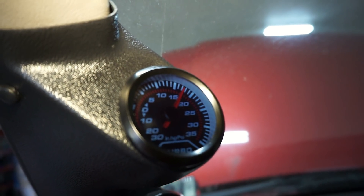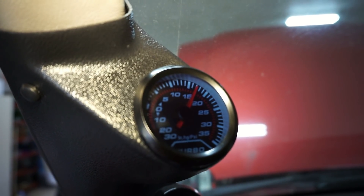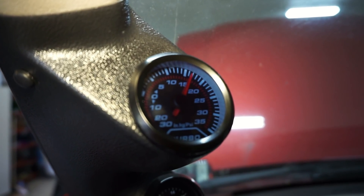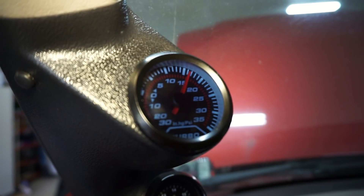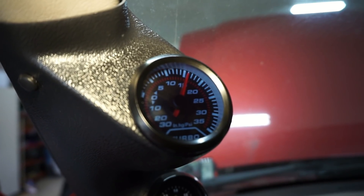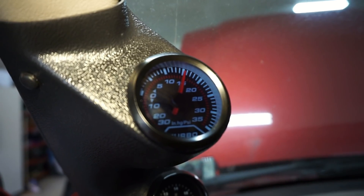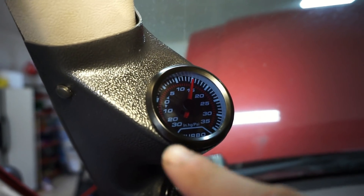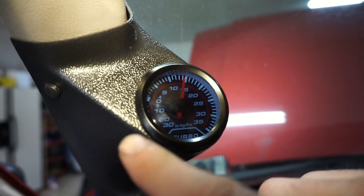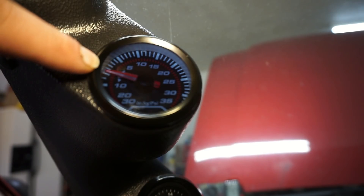You don't hear the buzzer, but we'll watch this thing come down and see when it actually turns on. There — it closes the circuit again around 17 pounds. So that thing's actually decent set around 17 pounds and this will stay on the whole way as it comes down, keeping that circuit closed so the computer would be on. But as it's swinging up it's really weird — it's intermittent and actually opening the circuit as it's swinging up.